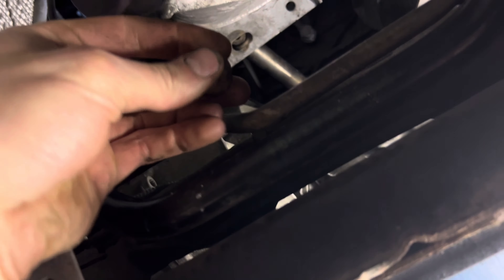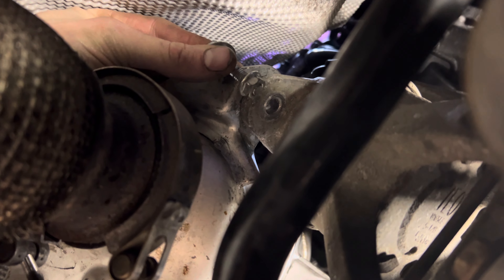There you go — I've already undone it. The screw should be facing down right here. Then you have a 16mm bolt at the end there, and a 13mm that sits right in here. This is a loose bolt, it'll just spin on the top, so you have to hold it on the top with something. Then your DPF is ready to come out.